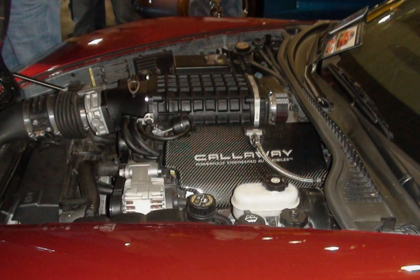The L8T is rated for 401 hp at 5,200 rpm and 464 lb-ft of torque at 4,000 rpm. The compression ratio is 10.8:1. The longer stroke yields little additional torque output compared to the L86. The stroke is also shorter than the LS7's 101.6 mm, perhaps to optimize rod ratio for reliability. This suggests that the engine was detuned for reliability with displacement rising to compensate, rather than allowing a highly-strung small block to experience failure in HD truck market applications.